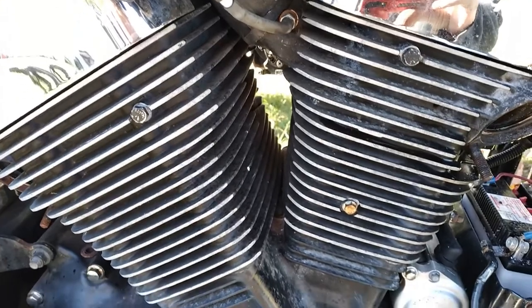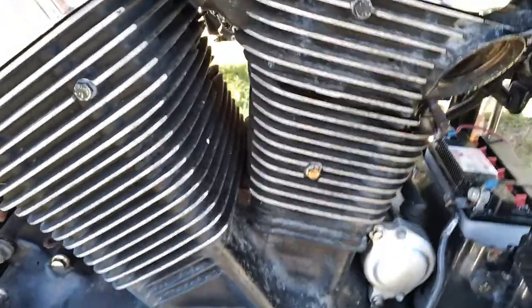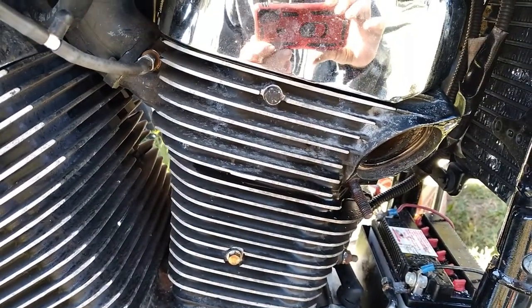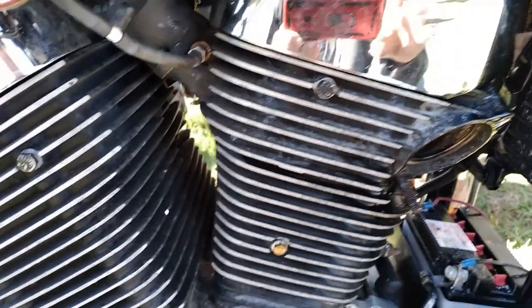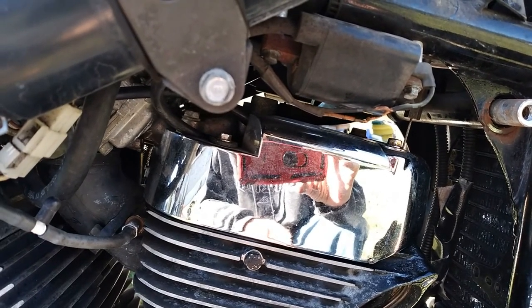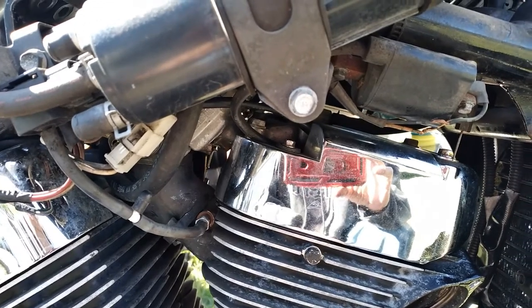I've had some starter issues — I'll go over that in the next video. I had to pull the starter off to bench test it and this front stud broke over here taking it out. Tried working it out a little bit at a time and it'd move a little bit, then just take it back in and it'd move a little bit. Heated it up, tried getting it out, and it finally just snapped off right at the inside of the head there. I'm going to go pick up my easy outs now — I've already drilled it. Easy outs are at the shop. See if we can't get that out. Next video I'll go over what I did with the starter.